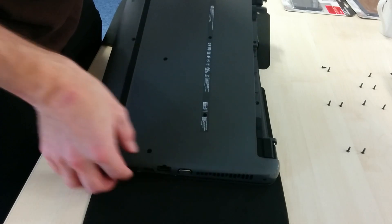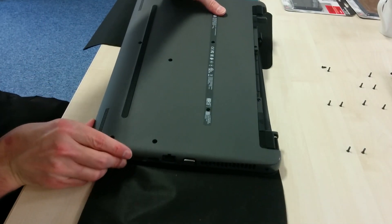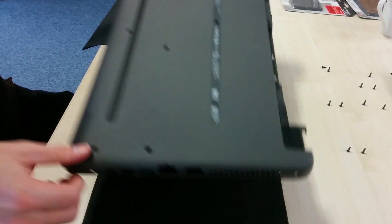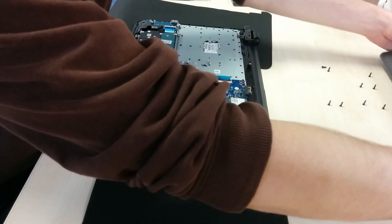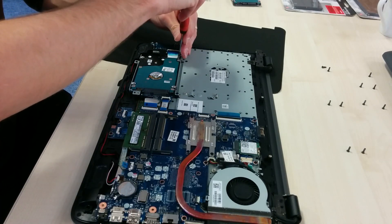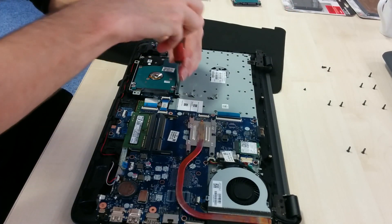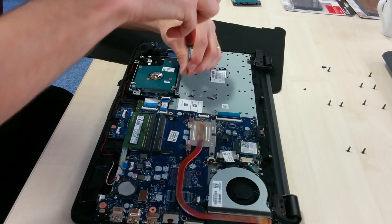Then hinge it so that you kind of hinge it away from the VGA connector which is closest to the camera, and the entire underside of the HP laptop comes off. That exposes the motherboard and BIOS battery, wireless card, memory, CPU, CPU fan, and obviously the hard disk.